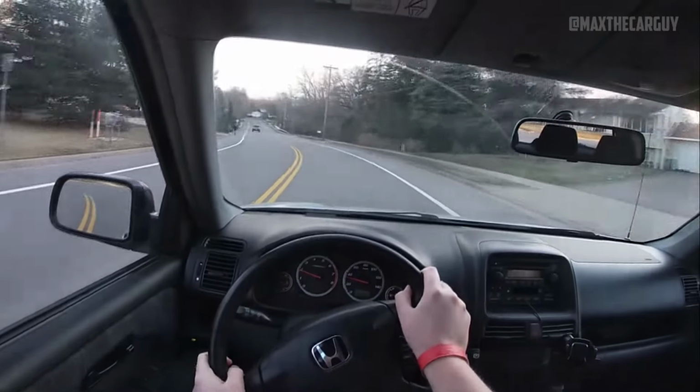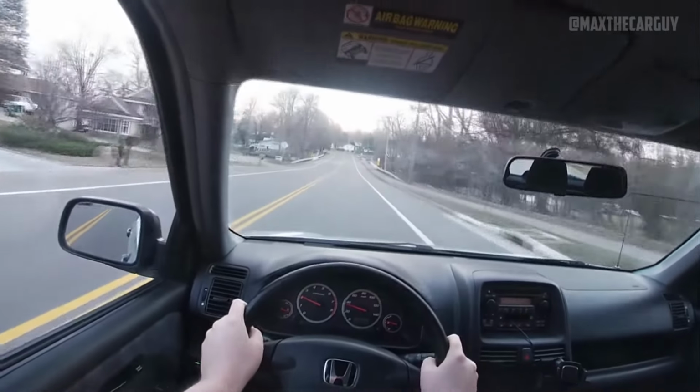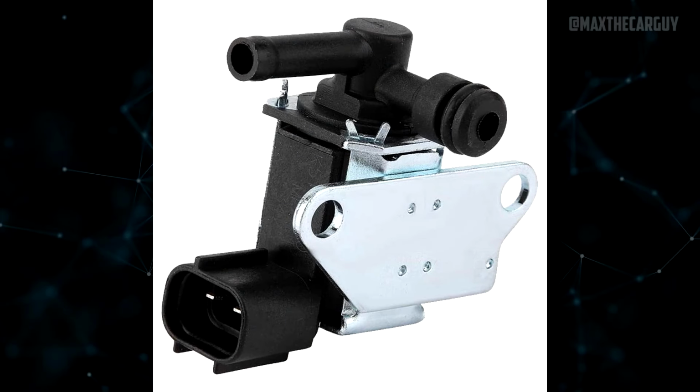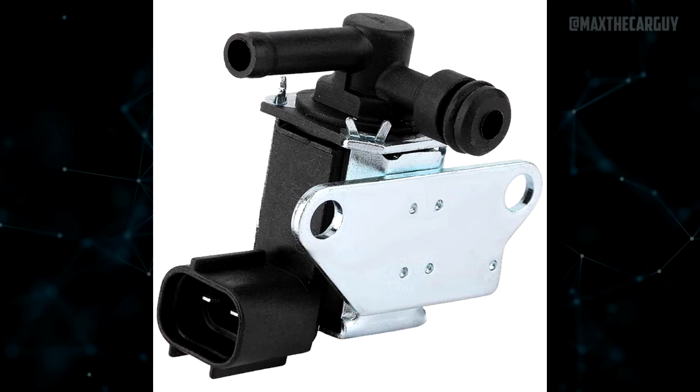According to Honda Service Bulletin 816, the fuel vent module, also known as the EVAP solenoid valve, can become blocked or restricted and result in the check engine code P1457. Honda suggests installing an EVAP solenoid valve kit to solve the issue. The valve itself, along with a number of tubes and other hardware, are all included in the kit.